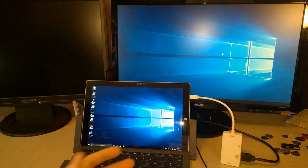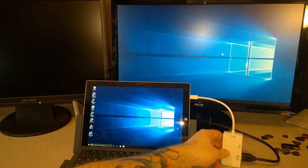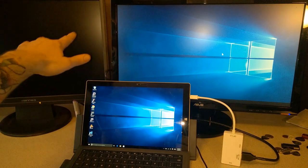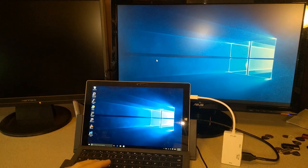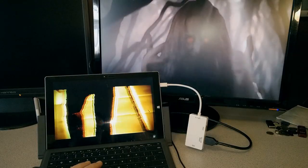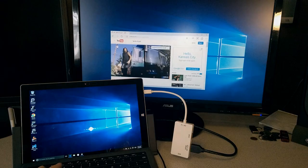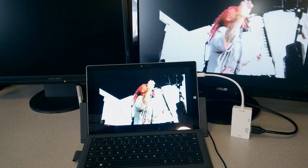I'd go for the VicTech because it's a little more stable with DVI. If you know you're going to be using HDMI, either one will work. The VicTech is $15, the WiMi is about $10. Actually, just grab both — sometimes it's cool to have two monitors sort of linked together, looks nice if you're playing a video. That's pretty much it for the VicTech mini DisplayPort adapter with DVI, HDMI, and VGA. It's DisplayPort 1.2, which is better than 1.1. About $15 on Amazon — link will be below.